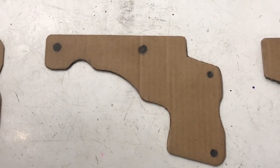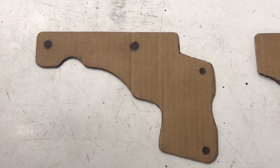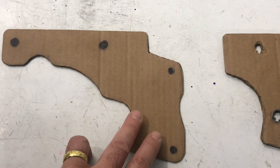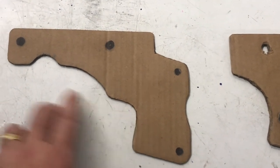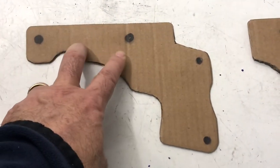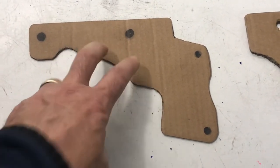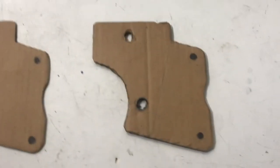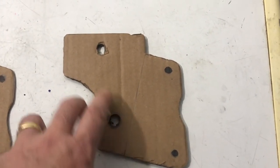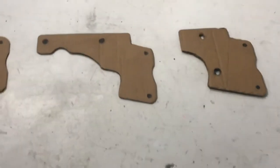The second design is similar to another builder's approach. It would attach to the inside face of my upright using two unoccupied holes on the upright, securing this without disturbing the hub bolts at all. The third is a hybrid approach: it takes the rearmost hole on the hub and an unoccupied hole on the upright to secure the bracket.